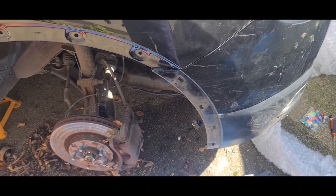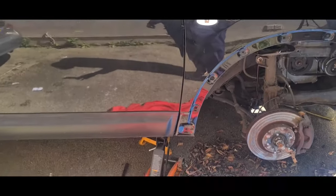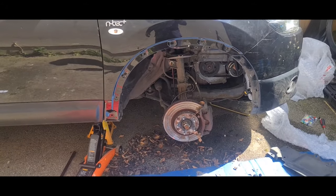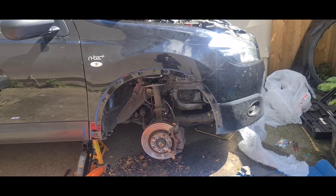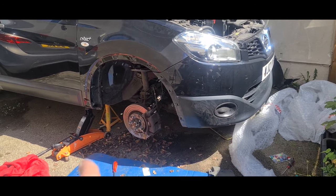I've had to cannibalise it off the old wing — it broke obviously trying to get it off, as these things always do. I've got it in there as best I can, but there's a little gap and this is very very loose. I'm going to try to basically wedge that in there with something. The gap seems okay overall — the wing to door gap looks pretty good all the way around, no problem there. There's a bit more of a gap at the bottom but I think that's where the arch trim goes, so hopefully that'll fix it. I've got very very little battery power, so apologies I can't put you on tripod. Everything is going back together pretty well. I'm really impressed with the way that bumper popped out with just a bit of hot water — that saved me an entire bumper.